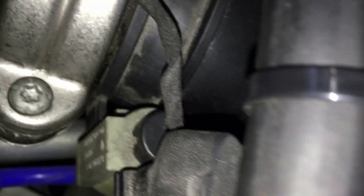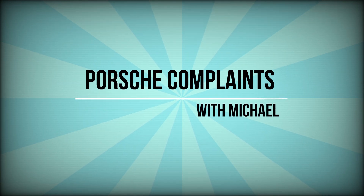Once again I was faced with another perfect example of Porsche's over-engineering. You'd expect the vacuum lines running to the actuators to be silicone or rubber, but they're not — they're a bunch of straight plastic straws, and every time there's a bend or turn they use a rubber hose to connect those pieces. There are about eight different joints on maybe a 12-inch section of vacuum routing, which doesn't make sense. And the bigger problem is that those plastic straw pieces weren't flared or ridged on the end — they were just slipped into the vacuum lines.